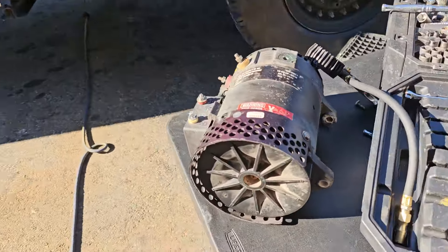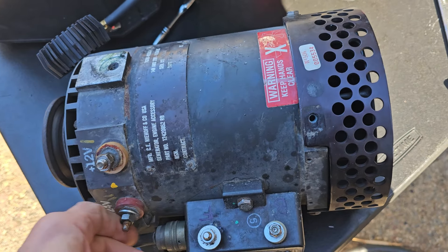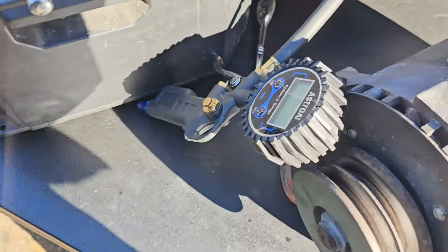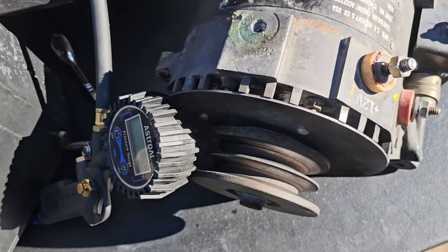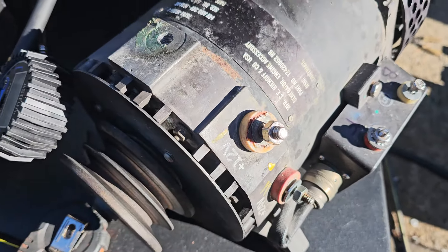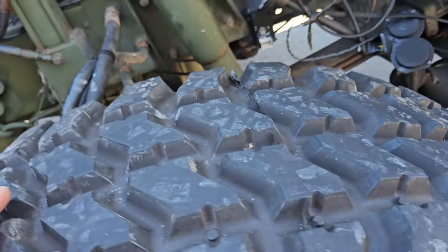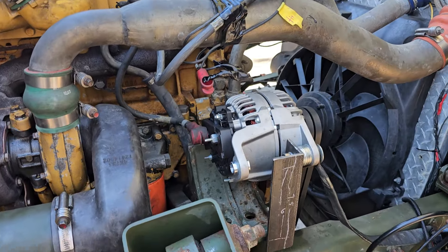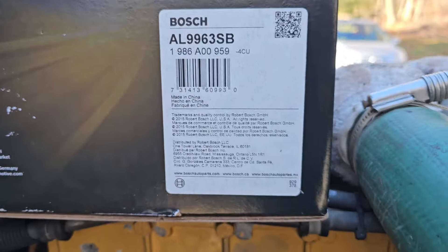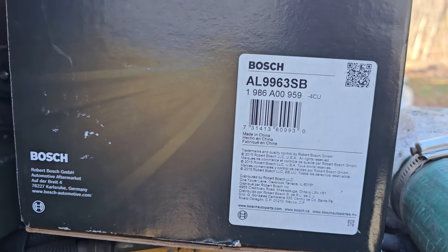Here's the upgrade conversion from this old broken, crappy 24/12 volt expensive original military alternator. It would stop working — the regulator doesn't have the lights on it. There's the original pulley. Let's take a quick measure on that pulley so we can see the difference. It measures four inches in diameter across the outside — just over four inches at the bottom of the V. And here's the replacement I chose, which is a Bosch alternator used for school buses — model AL9963SB.